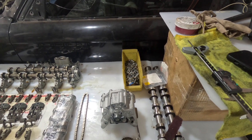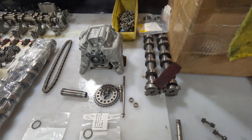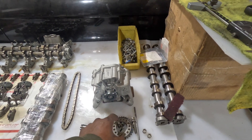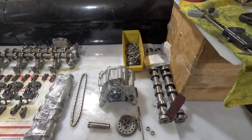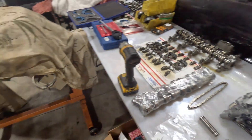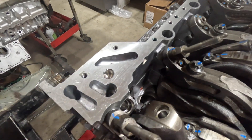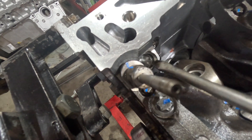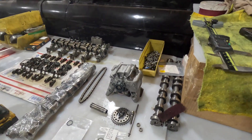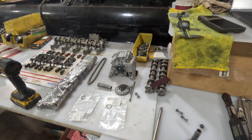We've got our chain, our suction tube, and another tube here - not sure if that's a drain tube or what. We've got our drive and our flange on the oil pump that the drive attaches to. We've got some new O-rings. First, we're going to put the new O-ring onto our sleeve, then replace the O-ring that's in the block right inside here, lube everything up, install the oil pump, and then torque this flange nut down.